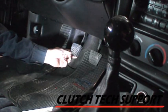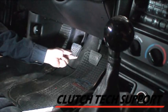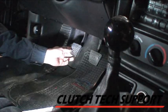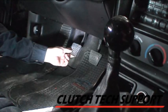It's time to bleed the hydraulic system. The system is completely connected. The reservoir has been filled up with fresh brake fluid, and Tim is underneath. We're doing this on the ground with the front end raised on jack stands, and I have to have the door open for this procedure. This is going to be a variation on brake bleeding, but we're going to change the sequence — we're going to start with an open bleed screw and then push the clutch pedal. Tim's underneath.